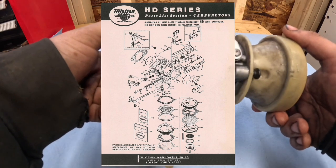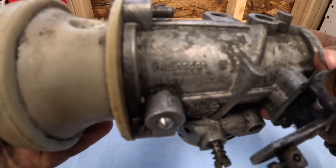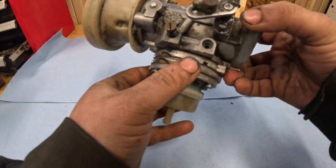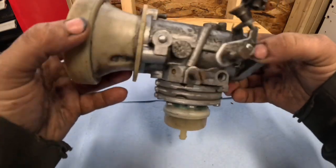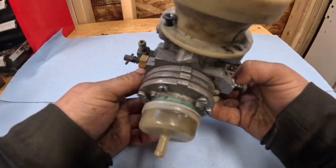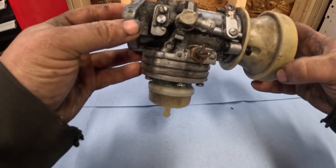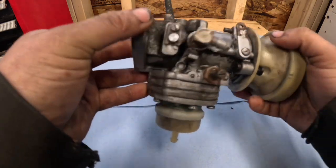These things have been around for a long time. I believe they were the first carburetors that were ever manufactured. They look kind of funny because they don't have a traditional float bowl on them. The fuel pump pulse lines actually ran right on the bottom of the carburetor, so there's no float bowl. The reason they did this was so that the engine can be mounted in any position and still run — upside down, on its side, whatever — and you don't have to worry about your floats or running out of fuel.